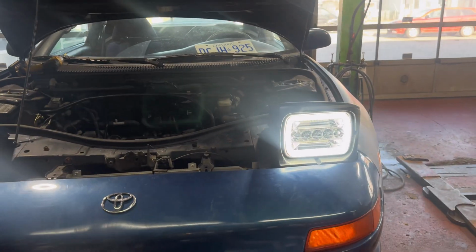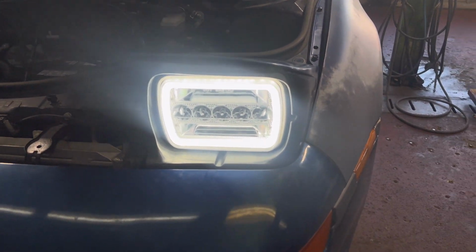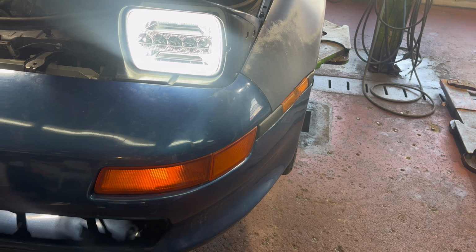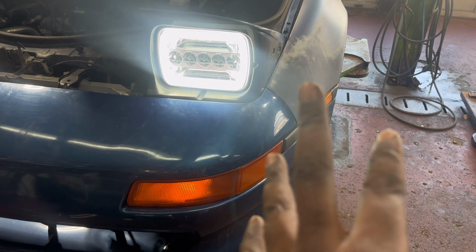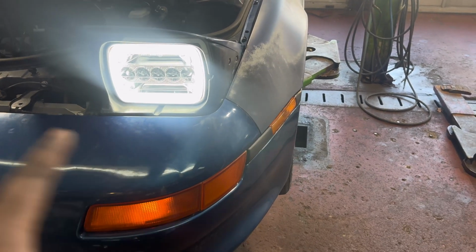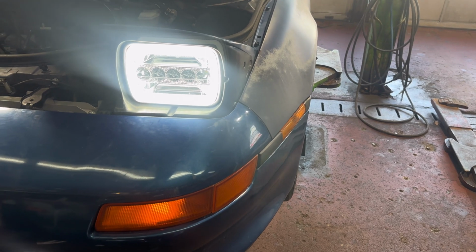All right. So as far as the wiring, on this side I told you guys the wires that are spliced together, the black and yellow wires off of the relay, is supposed to go to pretty much the low beam power. But with this harness, there's like a switched ground, so it's kind of weird to try and figure out the whole wiring setup.